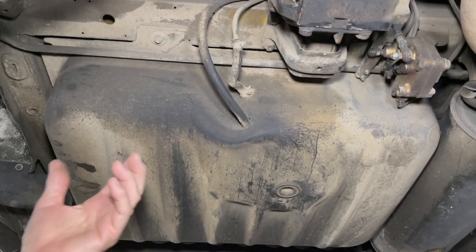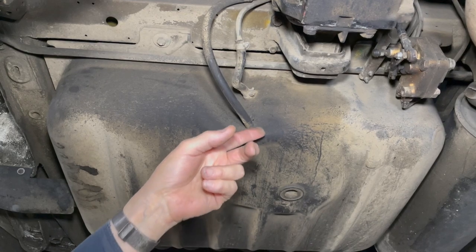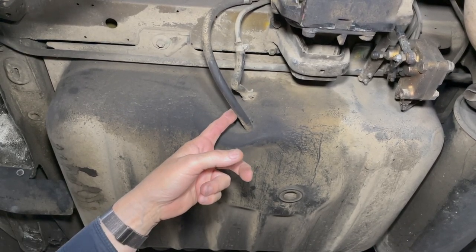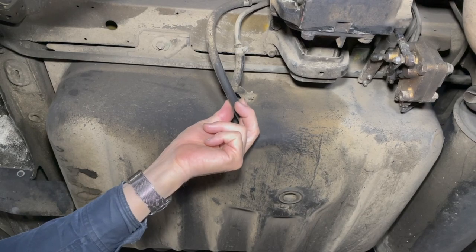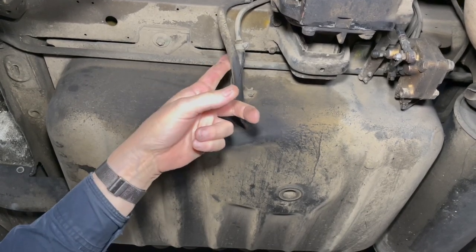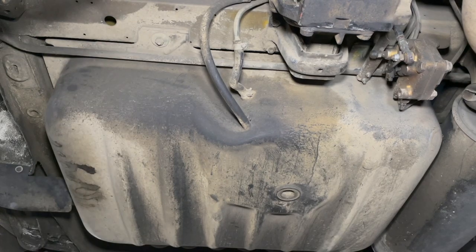In sedans I can enlarge the outlet because it's located up higher, but in the wagon there's really no way to without removing the tank and putting a great big fitting in. So what I decided to do was to come up with a heated sump that would heat the fuel right when it comes out of the tank. And with all my SVO single tank systems, I really believe in having a fuel pump back here to help push the vegetable oil up to the engine.